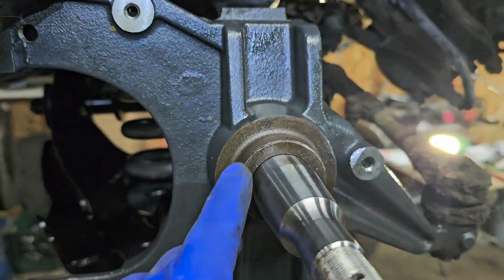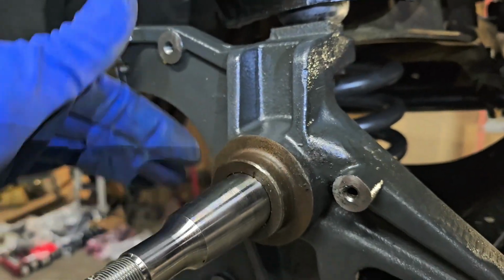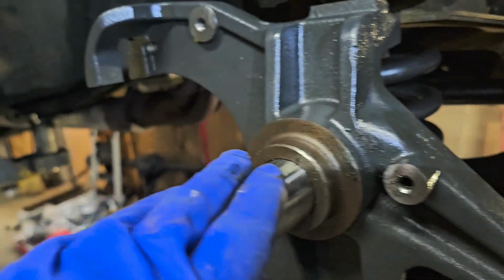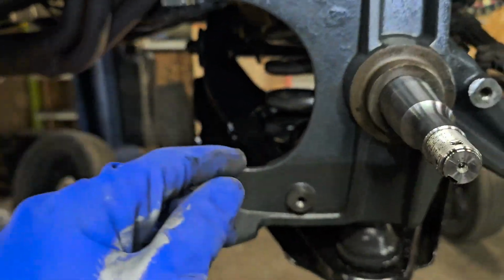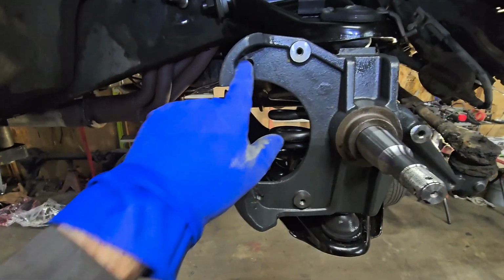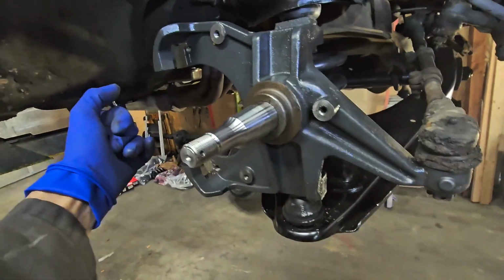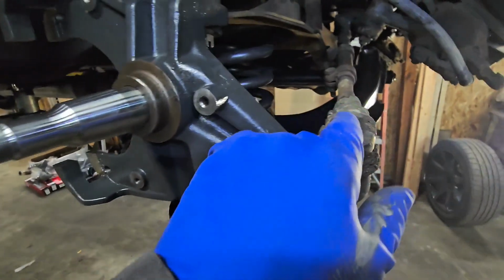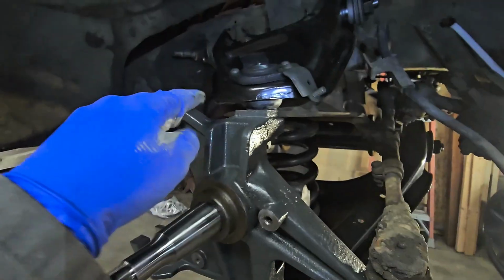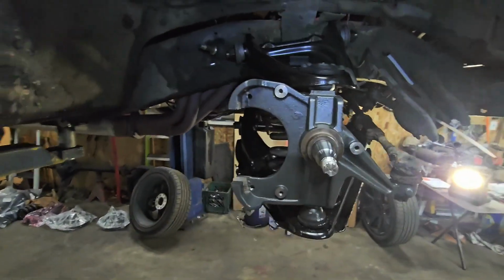We're going to go ahead and grab our old wheel bearings real quick off the old spindle. Put those on, and we got a brand new rotor, just old bearings. We're going to repack them. And then go ahead and situate. Okay, we're going to go ahead and those two bolts that hold on the brake hardware for the caliper. And boom, this side's pretty much done. Go ahead and re-grease everything you got. New grease, and call it a day.